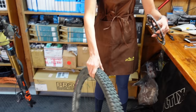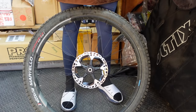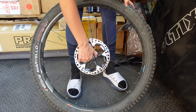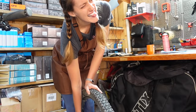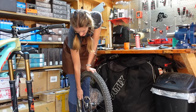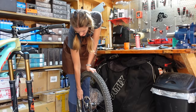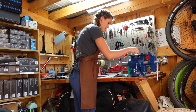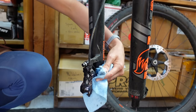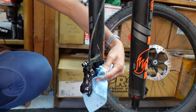Now pop the rotor back on the wheel. Tighten it tighter than you think — when I don't do it tight enough, it rattles loose; if you're a bigger rider, maybe slightly less. Then pads need to go back in. If the problem were a contaminant, it could be on the caliper, so go ahead and spray the caliper down and run a paper towel inside there and just wipe. Don't do this in your living room.